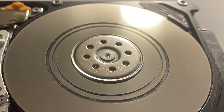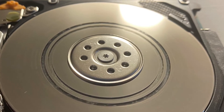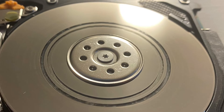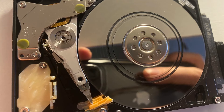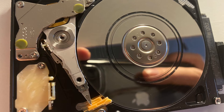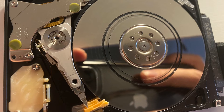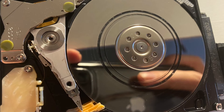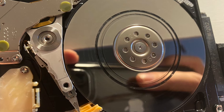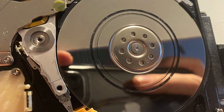The main thing that you can see on the platter, however, is that there are two different concentric rings where the read head physically touched the platter, crashed against it, and removed the recording medium off of the disc. And so now I'm going to play some of the recordings that I made that led up to the damage that is shown in the image on the video right now.